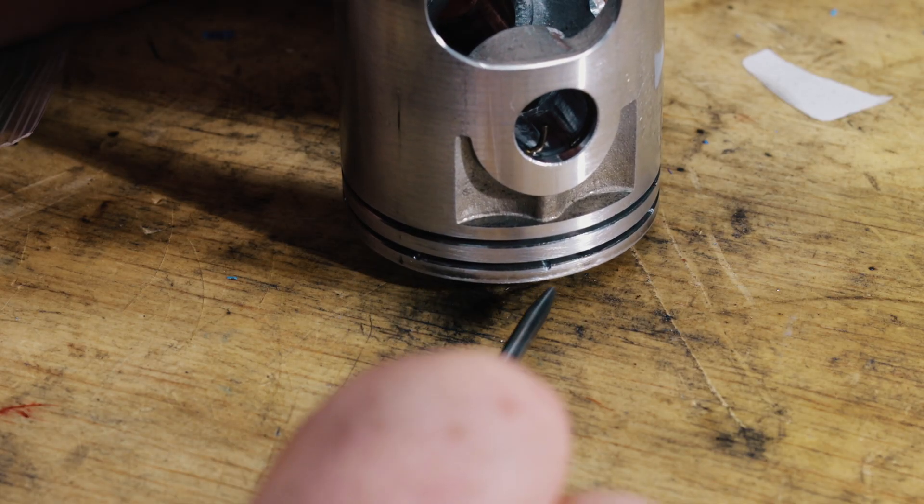I'm only going to use a single piston ring. Thank you all for watching. This piston is windowed and gas ported. I think this will be a big improvement in this Metra 70 kit. Let me know in the comments below what your piston mods are.